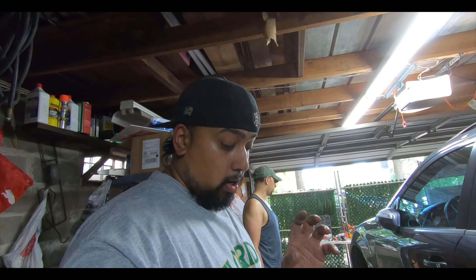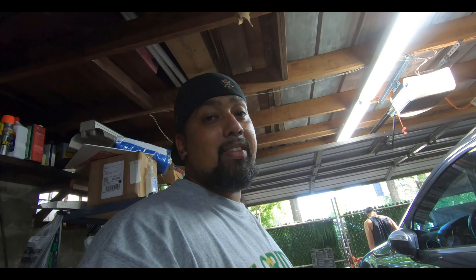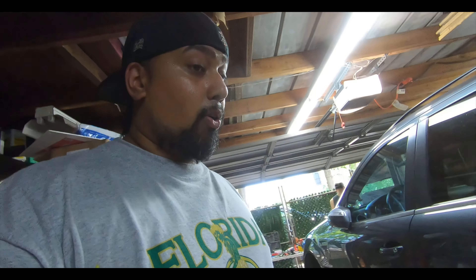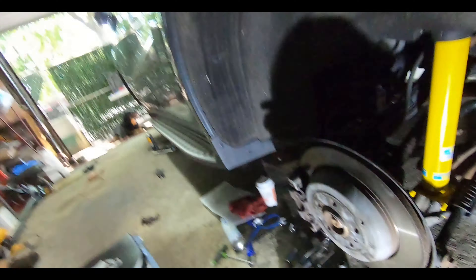That pretty much concludes doing your front and rear rotors and pads. I wanted drilled rear and front rotors and Brembo semi-metallic brake pads. I'm going to put all the information down below in the description. It was my fault — I ordered the wrong ones. The supplier Brake Performance does offer both 330mm and 350mm; you've got to make sure which ones you have. It might be a good idea to do a little bit of investigating on your car before you start ordering parts.